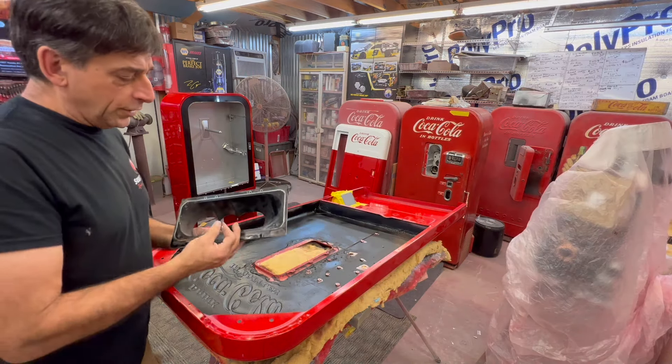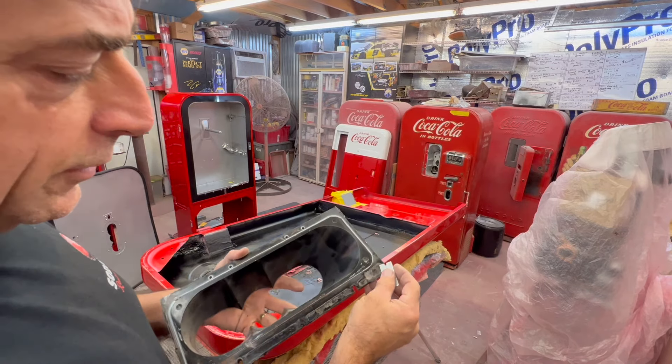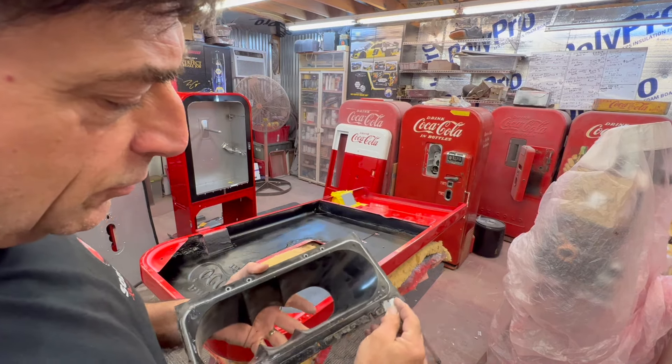Be really cautious when you're cleaning this plate up — don't dig in too much. We just want to clean that face up a little bit so we've got a nice flat edge, so when you set this back down it fits down there really nice. We're going to use a little bit of a gray Scotch-Brite pad and just a little bit of water — spray that down just a little bit. Give it a good scrub down, get into all the little crevices. Scotch-Brite works great for this area.